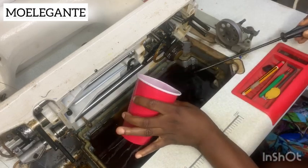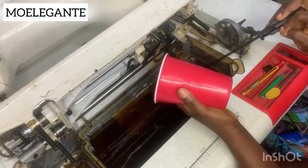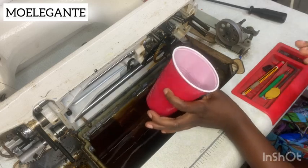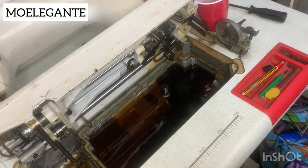Let me show you the underside of the machine. When you unscrew that nut inside the basin, you can see that little opening — that's where the oil will be coming out from. Make sure you place your container under this, or ask someone to place a container close to that hole before you start unscrewing the nut that they use as the stopper.